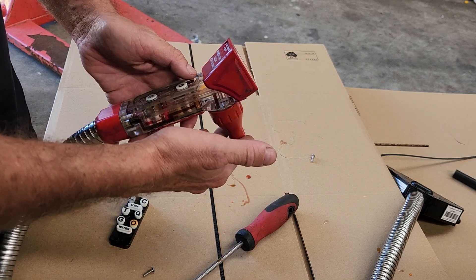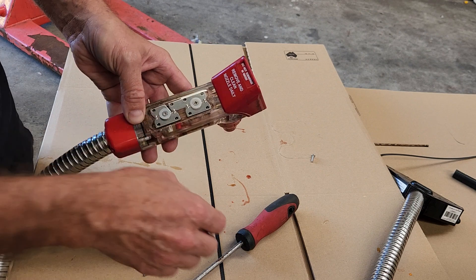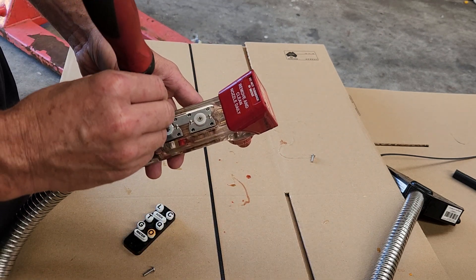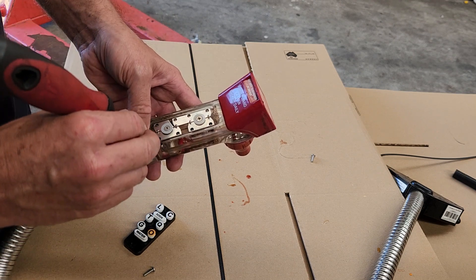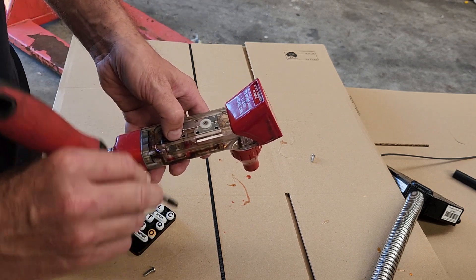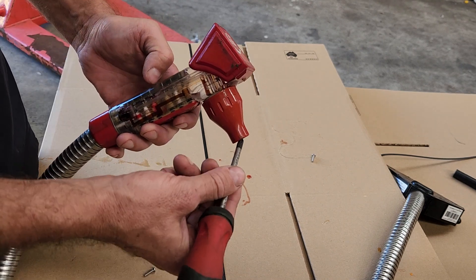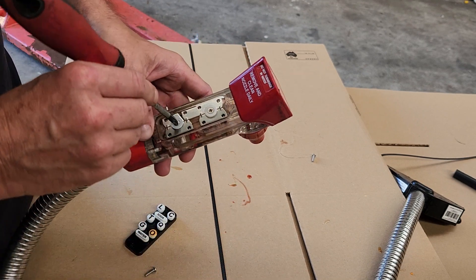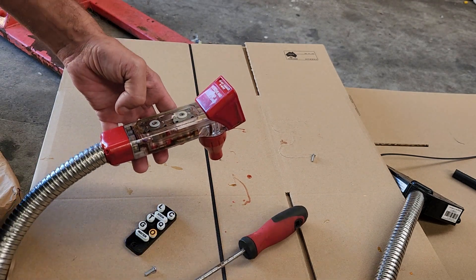Make sure you've got plain water coming out. If it does, it's a button issue. When screwing these in, just tighten up - don't over-tighten. If you over-tighten, it will hold the plate down rather than just holding it in place, and water or soda water will continuously come out. If that happens, simply open the gun up and back the screw off a little bit.